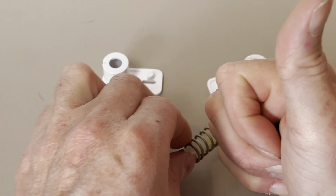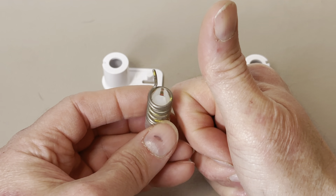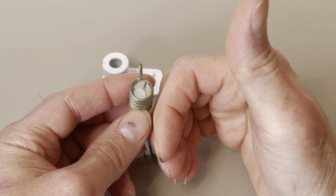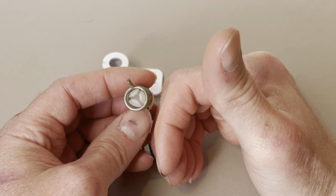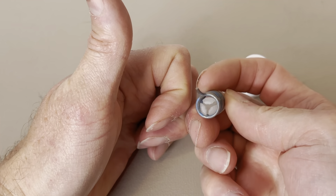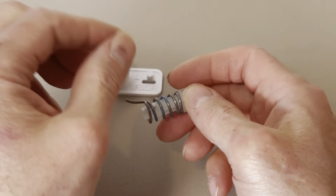What I mean by that — if you look, the right spring has a little thumb that points up, and if the spring curls around in the direction of my fingers, you have the right side spring. And likewise, left thumbs up and the left spring: if the spring curls around in that direction, you have a left-hand spring.